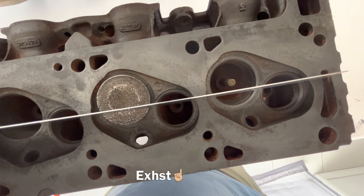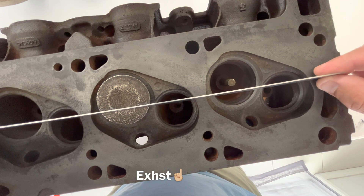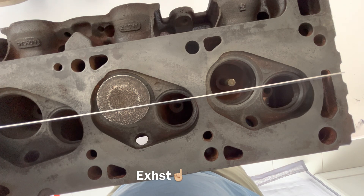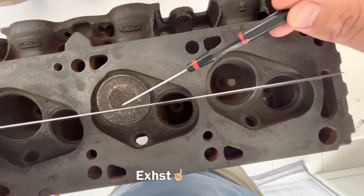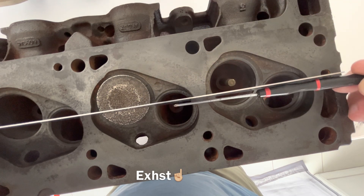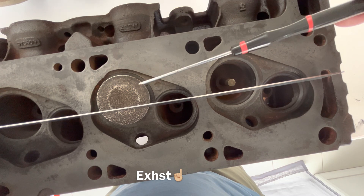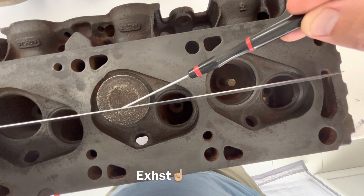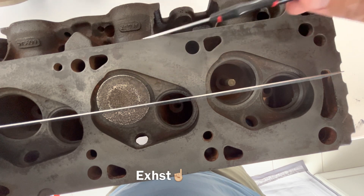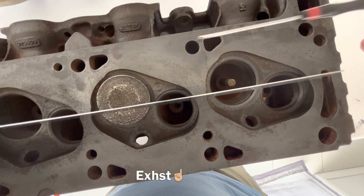That's your staggered valve arrangement. The straight edge I have here is pretty much the center of the cylinder, and what's happening is the port is all the way out there on the intake end, and then you have a shorter end when it comes to the exhaust port. That's a pretty good ratio - the Cleveland's being a little longer on the intake end because Cleveland's tend to be larger on the intake ports, both 2V and 4V. The ratio there compared to a shorter travel getting the gases out to your primaries is probably beneficial in the design of this Cleveland head.